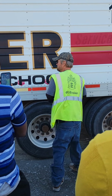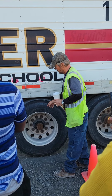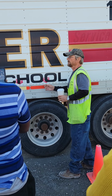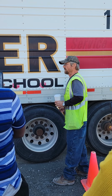Now my tires. Same thing as on the drives. Okay, my tires, rims, lug nuts, inner and outer hub seal. And spacing. I'm going to inspect the same as I did on my drives. Not cracked or broken, mounted and secured. The tire depth cannot be less than 2/32.